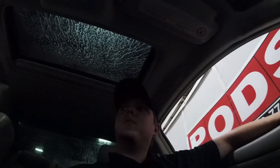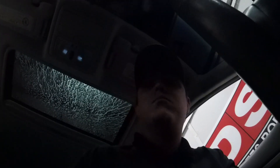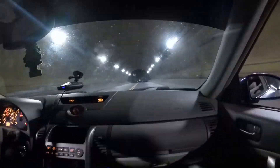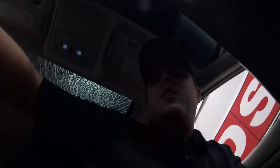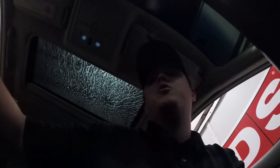So it's been a minute since I've filmed anything — I've been so busy at work. I got the G running straight, but there are still a few kinks. The slave cylinder keeps leaking so my clutch keeps losing pressure. I've put like four crush washers on it and it still seems to be leaking. The G has also been acting really weird with the ABS — it's like it resets every time I start it and it's kicking back and forth. So I'm just going to completely disconnect the VDC yaw sensor.